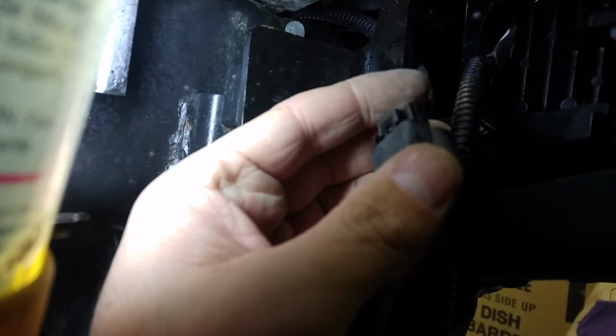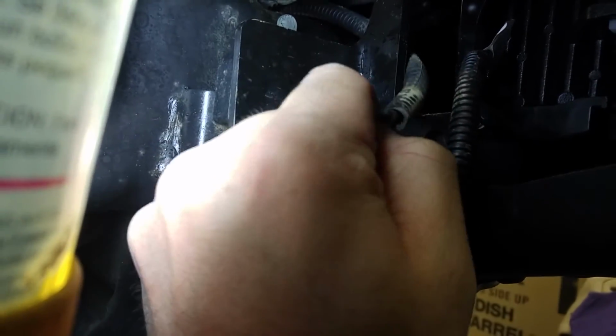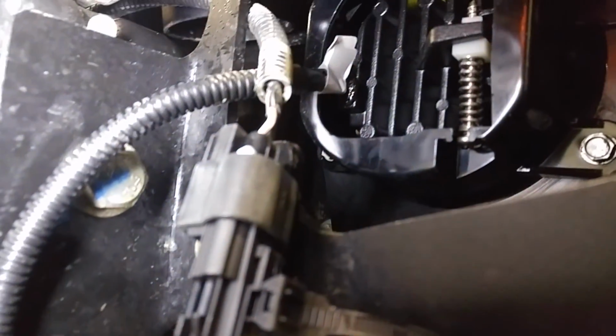And when those slide in, you slide them all the way, you'll hear a click, and then once they're there, they're locked into place. And now this plug is as good as new, but no need to cut the wires, solder them together, just replace the plug, and then plug it in. There they are. And then we'll clean up the wiring here, tuck it in, adjust the fog lights, and off and wheeling away.